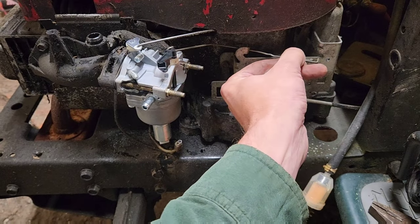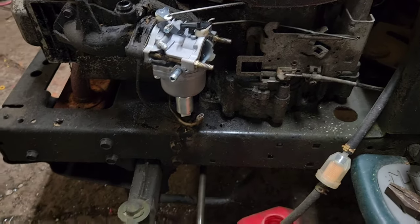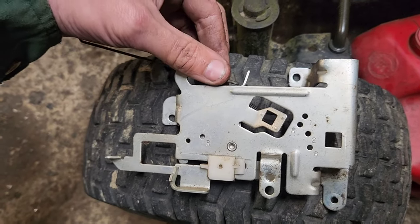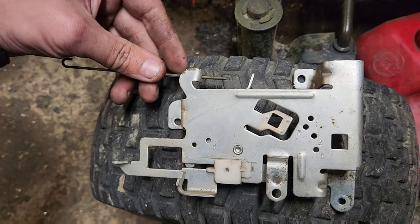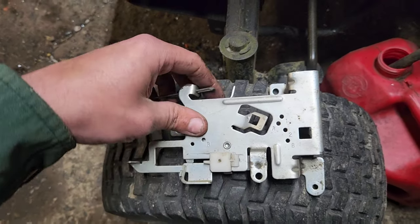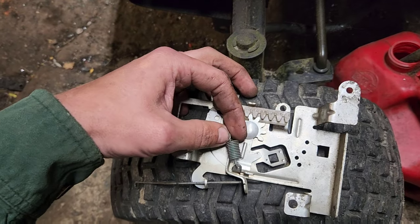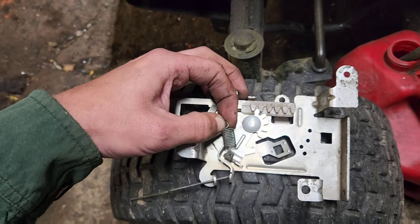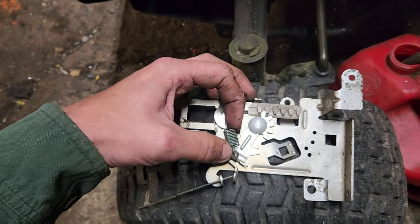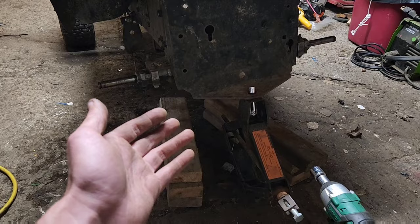This is how you fabricate a really quick independent choke. Right now we have no choke — pull this and push it over and you've got choke to start, then pull it back, pop it in the hole, and you're running. When the lever comes up it pushes the choke closed to start, then it comes back while you run through your RPM band. If you want a little more RPM capability on your throttle, the spring on the back side controls your governor pull — tighten it or zip-tie it for a direct governor connection to get more RPM when you upgrade to a gas pedal later.